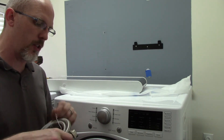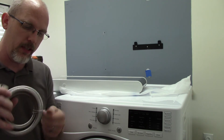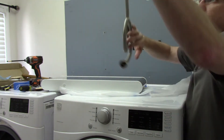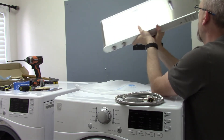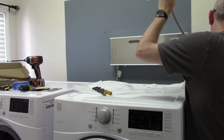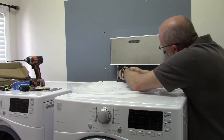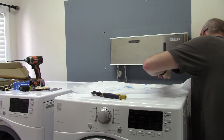I've got really high quality stainless steel hoses already, and I don't want to have to undo everything on the washer. So I'm only going to use one of the supplied hoses and keep my other good stainless steel braided hose on the washer. On the bottom it's marked in and out, so I'm going to move my outline that goes to the washer here, and then put the in line there. When you snug up on any fittings like this, you don't have to go super tight — just slightly beyond finger tight so that it compresses the rubber washer inside. If you try and crank down, you're going to end up destroying the neck or the device inside.